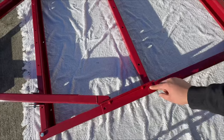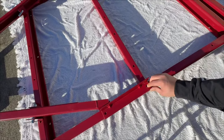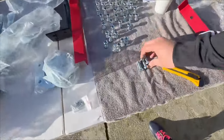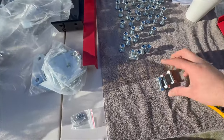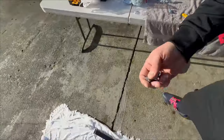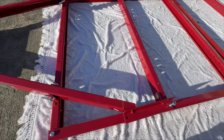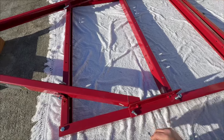And for here, where it's supposed to use the bolt to catch three pieces of metal, 1, 2, 3, we're gonna use the long bolt. You're gonna find in all the bolts, there are three long, so you're gonna use just two bolts, and I'm gonna put here a long bolt, here a short bolt, and here a short bolt too.